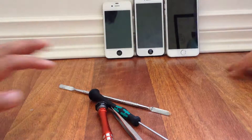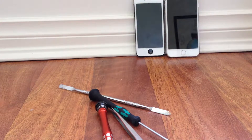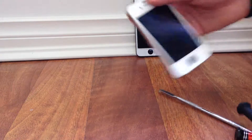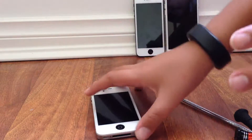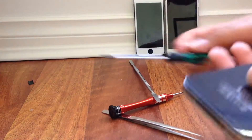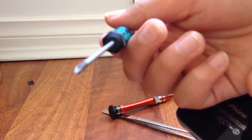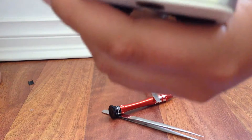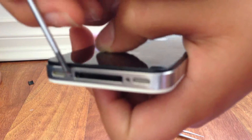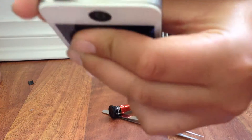So first of all, the iPhone 4 — I'm actually recording with my iPhone 5 at the moment. These are all Bobby's phones. To start opening the iPhone 4, you've got this tool here — screwdrivers and a tweezer-type thing. You're going to see two screws on each side of the lightning port, the charging area, and you unscrew them.